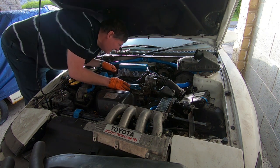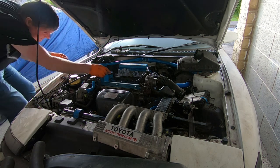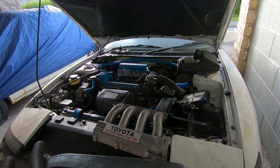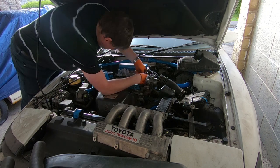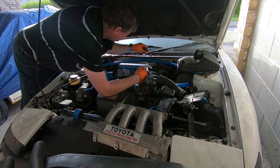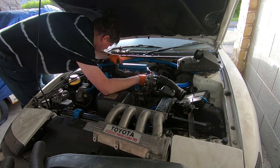It's the injectors, let's have a look. Looks like, is it 10 or a 12? We'll just try the 3/8. The plastic cover. No, it's not a 12, so it must be 10. Get that bolt out. Should free off this cover. And you can tell somebody's been in here before.